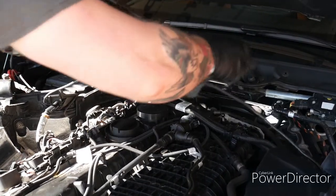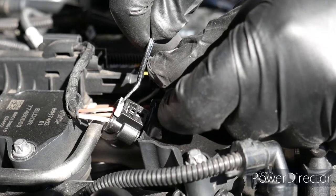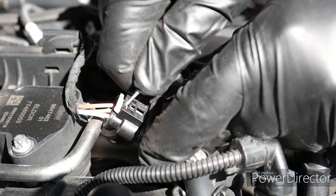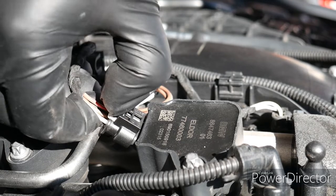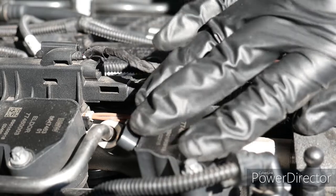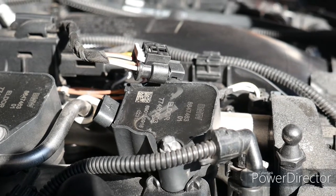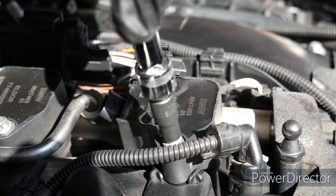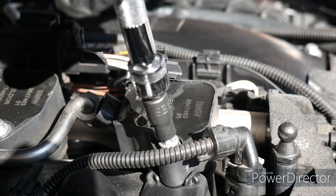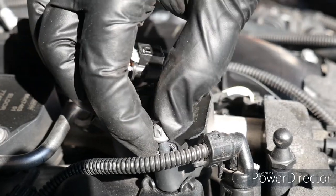This is also where your fuel pump is. So we're going to disconnect this clip here. I find it easiest to use a pick tool — pop under there and just push up. Then squeeze it together as you pull it out. Here we're going to take an external Torx star socket, it's an E8, and just loosen this. Remember that this bolt doesn't actually come all the way out — it is part of the assembly.